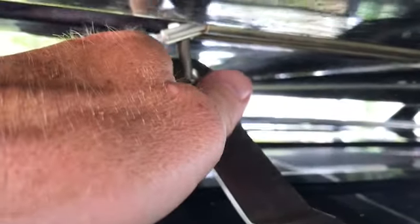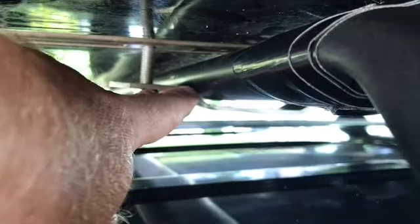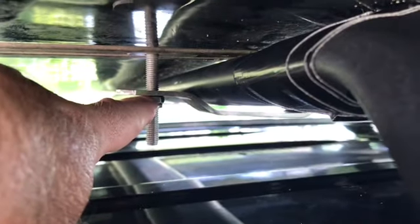You push it up into that track, right? And then you can pull it forward. So now I slid through that. That's the shorter 40mm bolt towards the inside of the car. The 60mm bolt that came with it is at the outside of the car. This whole assembly, right, with the bracket, the bolt, and the locking nut.